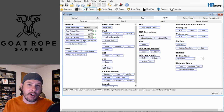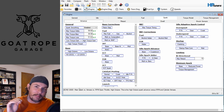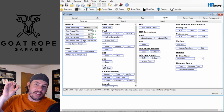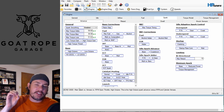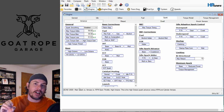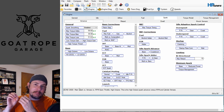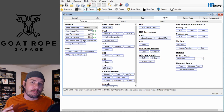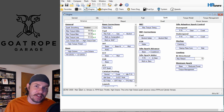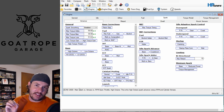When we talk about timing, we're talking about degrees of timing - specifically how many degrees before top dead center we want to initiate spark. That's why we call it timing advance. If you have 20 degrees of timing, that means 20 degrees before the piston fully compresses the air-fuel mixture, we light off the spark plug. It takes a little while for that mixture to fully burn and reach the point where it provides the most energy to drive the piston back down.